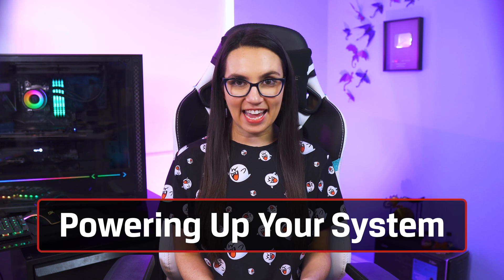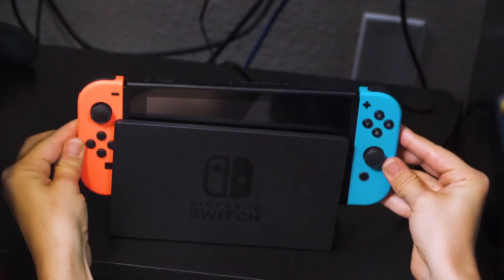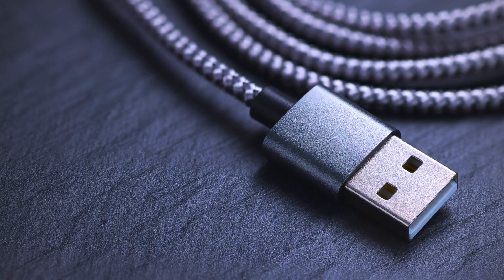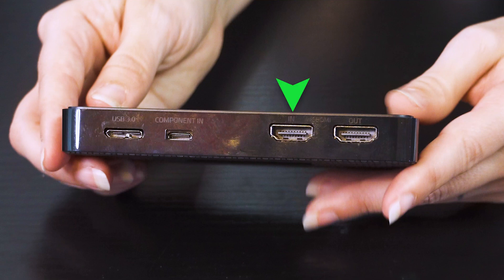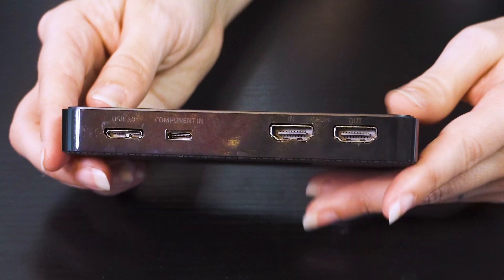Now that we've got our hardware in hand, the first thing you'll want to do is plug in both the power cable and the HDMI to your Switch dock, and place your Switch right inside of it, removing the Joy-Cons so you'll have them in hand to play. Next, plug in power to both your PC and your capture card if it needs it, and connect the capture card to the PC either by installing it internally or via USB cable. Note that some capture cards are powered by that USB cable and won't require a separate power cable. You'll then want to connect the HDMI from your Switch dock to the capture card in the port that says IN. If you have a separate display, you can use another HDMI to connect that display to the port on your capture card that says OUT.